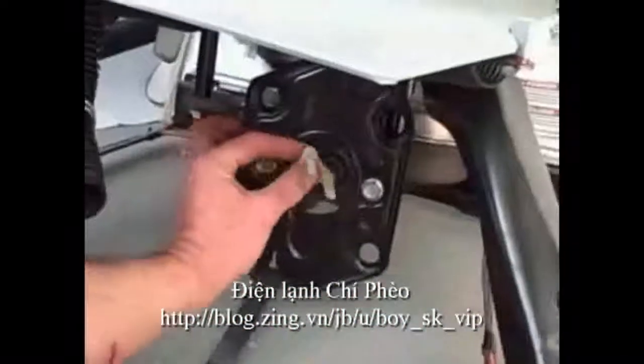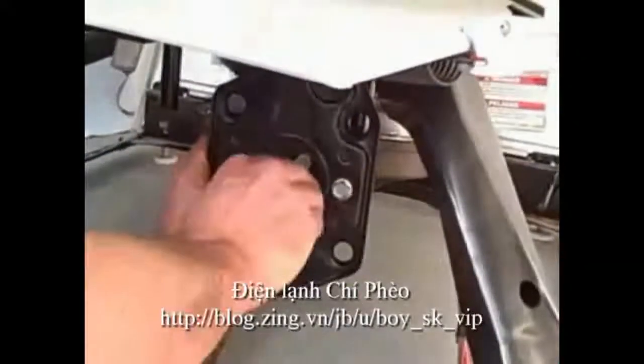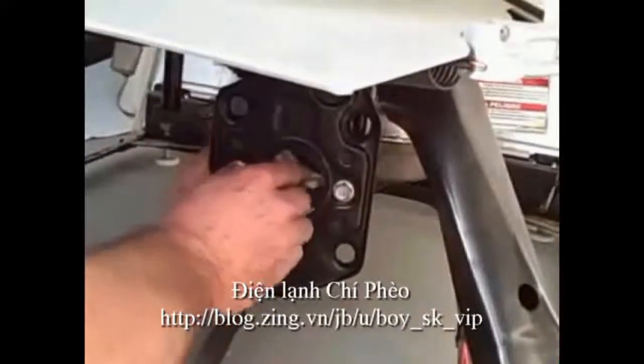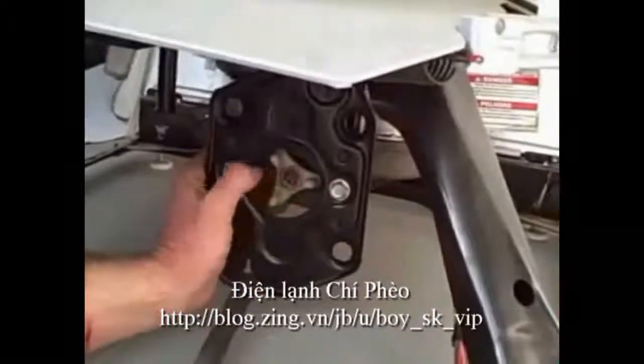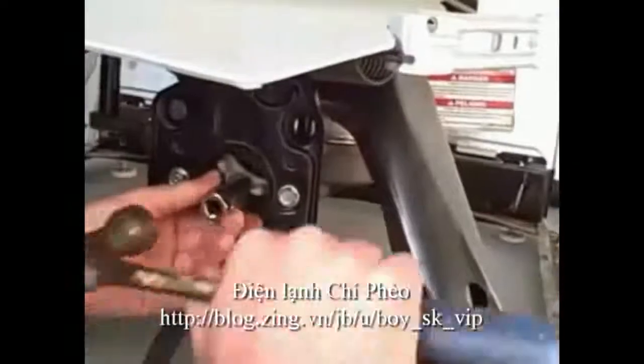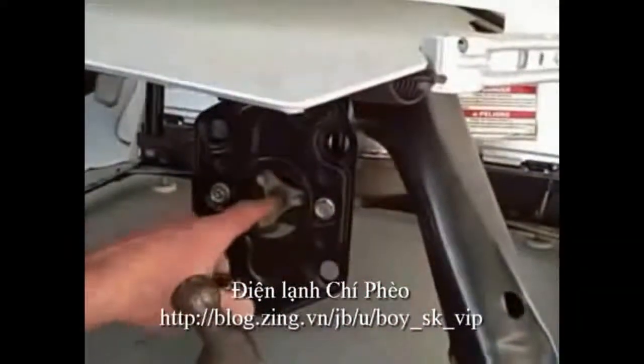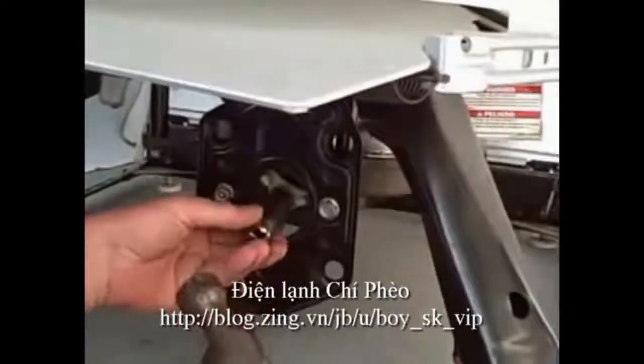To install the coupler, separate the couplers into 3 components. Place one of them on the spline of the transmission. Turn until it lines up. Grab a spark plug socket and your hammer and tap into position. We would like to see the spline even with the coupler.